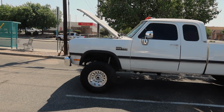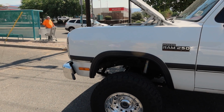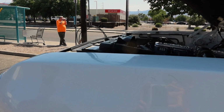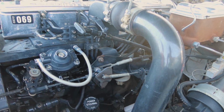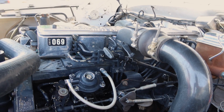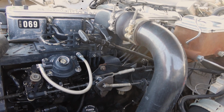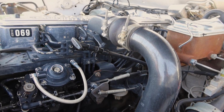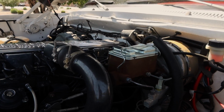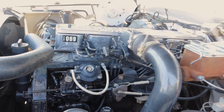Very slick truck. It's all factory for the most part, right? Yes, sir. Under the hood, it's factory fuel for the most part. Some pump work, obviously, a piston lift pump, stock injectors, HX35. Looks like a lift pump and then that bigger fuel filter. Deleted the fuel heater, just the typical stuff. This thing is a Getrag, so it is a 5-speed and has good manners. I rode in it last night. We actually did get pulled over, but for a stock truck, this thing runs very healthy.